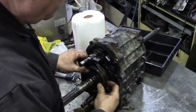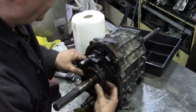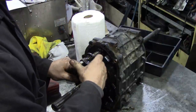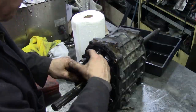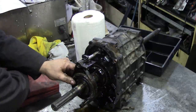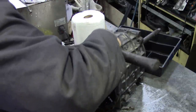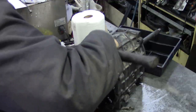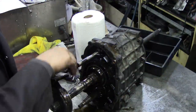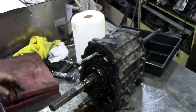Just be careful and keep your fingers around the synchro and pull that piece off. There we go - you might have to wiggle it a bit, it'll come. There we go. This is absolutely filthy, might need a bit of persuasion. Let's see if it'll tap. There we go - because there might be a little bit of a burr where the hole is for the grub screw. So we've got that bit off - we're going to keep that piece all together. We'll look at all these pieces individually. Right, that's that off.